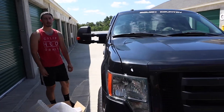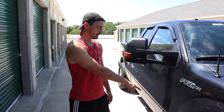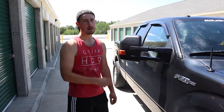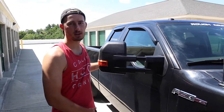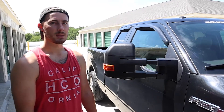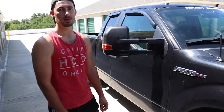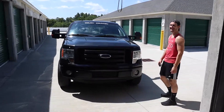If you guys need to take out the master switch for lock or unlock, replace door glass, or anything like that — I encourage you to try it yourself. There are two tiny 6mm bolts at the very bottom, two 8mm bolts at the top behind those caps, and three 11mm nuts that hold the actual mirror onto the truck. That's all you need. I would not take it to a shop — somebody who doesn't know anything about cars could watch this video and go do it themselves.